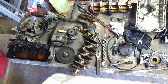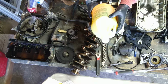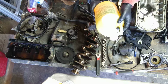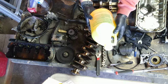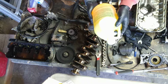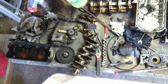So, label says, for stripping sealers, nope, not doing that. For grease buildup on concrete floors, nope, not doing that. For greasy machinery, tools, etc., dilute 1 part degreaser to 26 parts water. Do not soak parts longer than 5 minutes. Immediately clean and remove grease from metal surfaces using a brush. To prevent rusting, rinse with water and dry immediately.